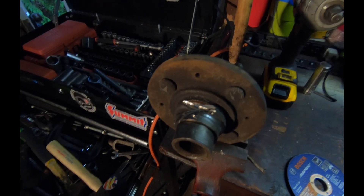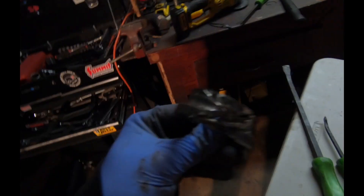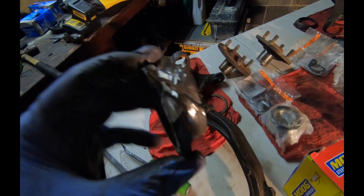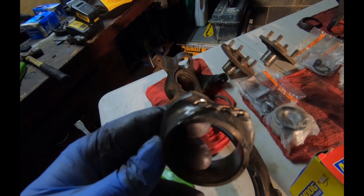Just trying to show you guys — if you can see, I cut into it and I'm almost at the hub. This thing should be off in the next few minutes. Fast forward — this is the piece I grinded off. If you don't have a bearing puller, this is really the only way — you've got to loosen the strength of the metal so it slides off the hub. Once you get these off, we can start reassembling the knuckles.